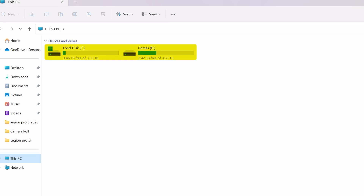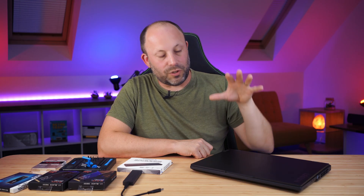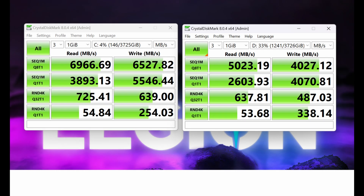Now running from the new SN850X primary drive, I ran CrystalDiskMark to test the speeds. The SN850X delivers absolutely incredible scores for a primary drive — perfect for OS use and anything that heavily utilizes the disk. The P3 Plus 4TB secondary drive also gave very impressive scores in CrystalDiskMark, though it does drop off once the cache runs out under sustained writes. For a games drive it's absolutely perfect — games load very quickly and you're not getting massive sustained reads or writes during gameplay.